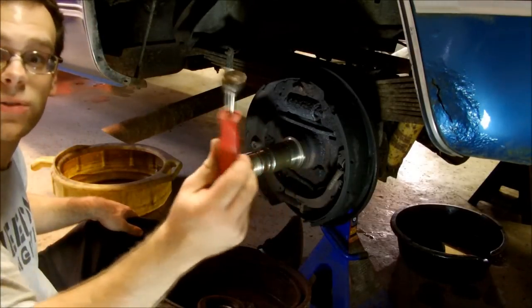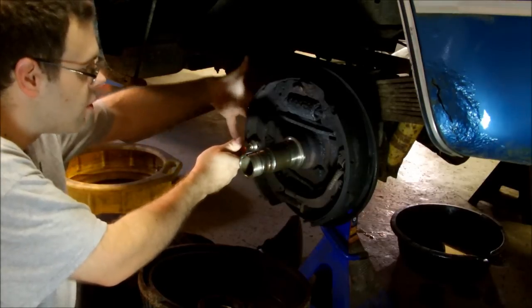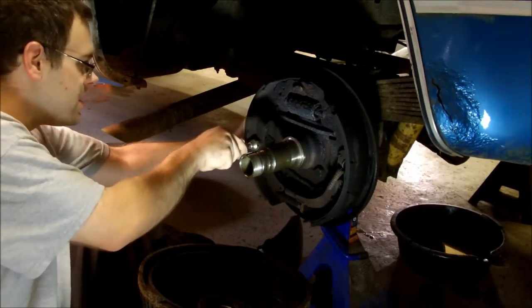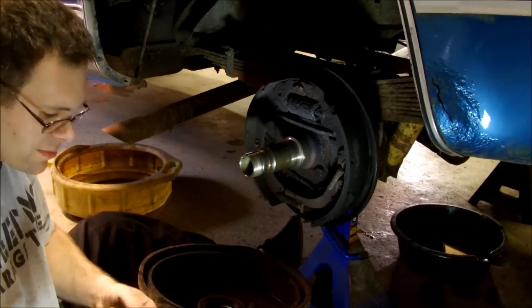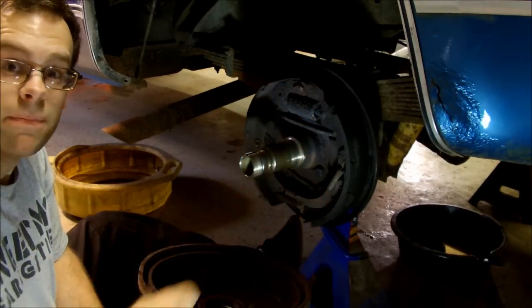Now this little hold down tool I was talking about goes right on these cups. There's a pin on the back. Hold that, you push this in, do a quarter turn. This hold down spring comes off. You'll see these hold downs have a little notch in them.